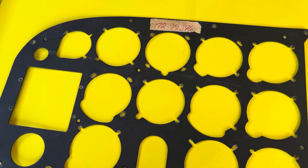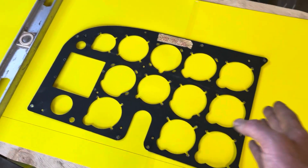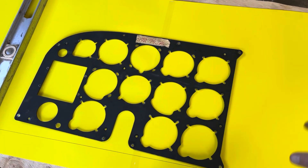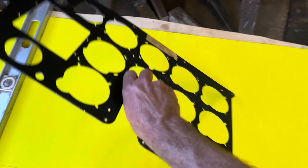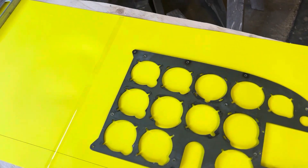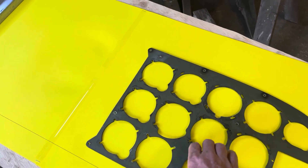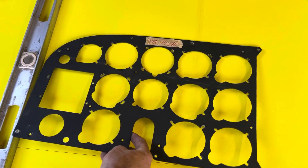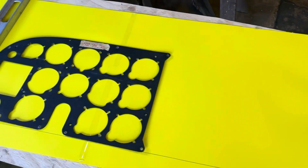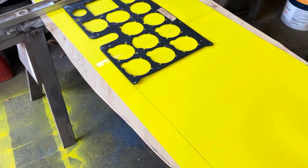Everything else can get blanked off. What I've realised is that the panel on the left side — as much as it doesn't look it when you're looking at the whole panel with the radio stack in the middle — is actually identical in size, if you mirrored it, to the panel on the right, as far as the overall shape anyway, not the bits in the middle. So that's why I'm just using one half, the pilot side, to measure it out and trace the whole thing. I'll flip it over and basically have an outline of the whole panel, and then I can start placing where the gear's going to go.